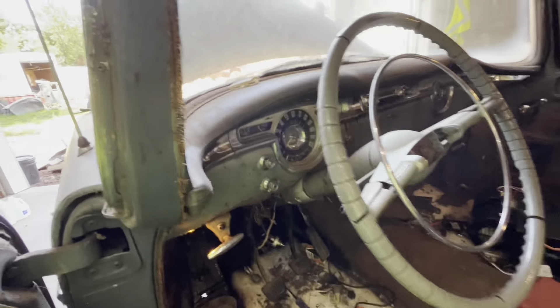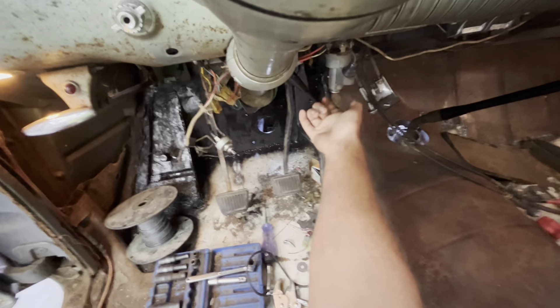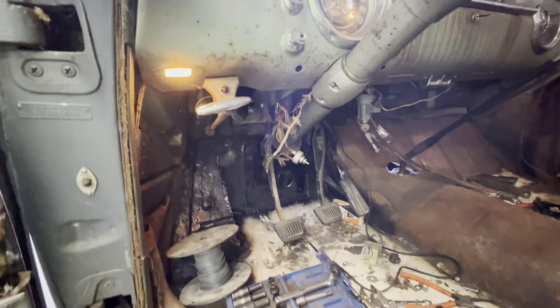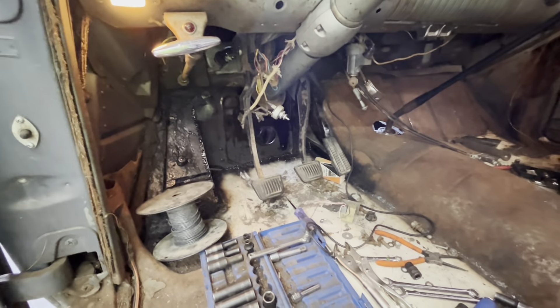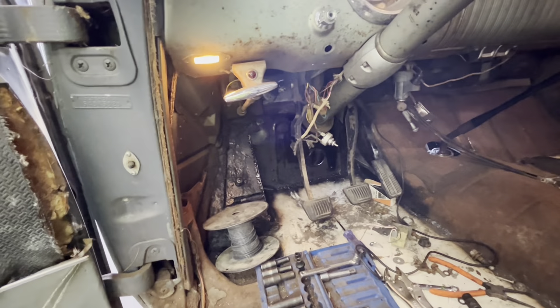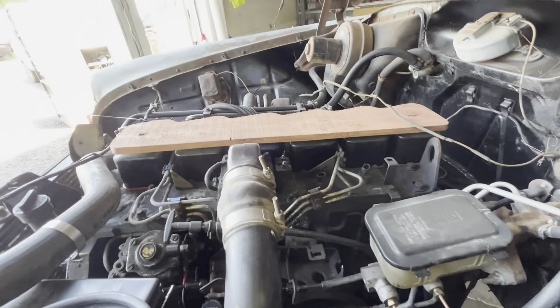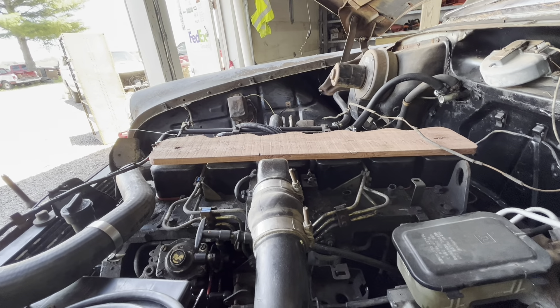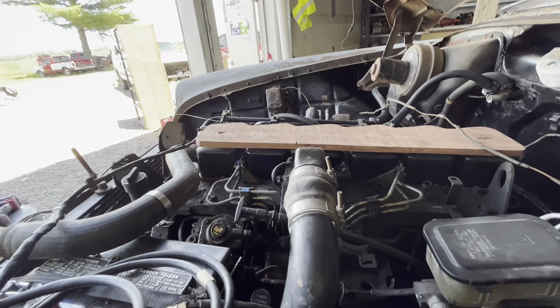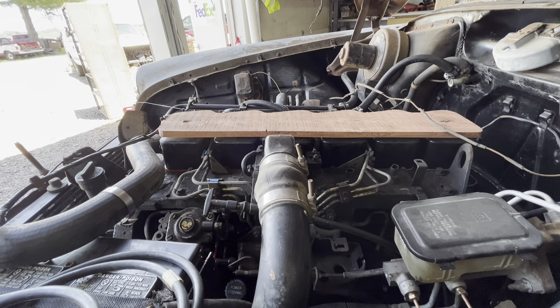I got all the lights working, got the brake lights working. I don't have the reverse lights working yet, but I think I can make those work. I figured out the wiring for the Getrag — it's just a switch on the side of the transmission. I got dome lights that come on when the door opens. The signals are running off the factory switch and the motor starts off the factory switch. I also got my throttle pedal figured out — I think I may have filmed that little bracket I made that goes through the firewall. I got the Hydra Boost bled, which took about two hours — that was a nightmare — but we finally got it all bled and we've got power steering and power brakes now.